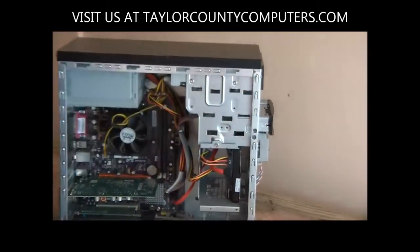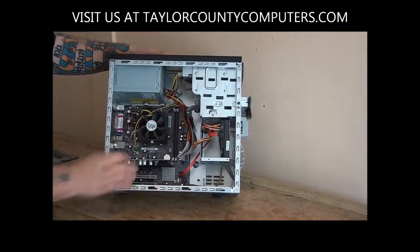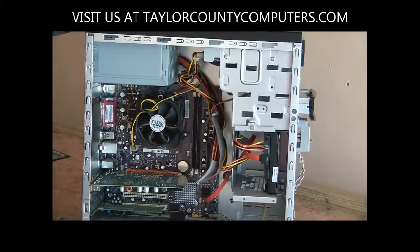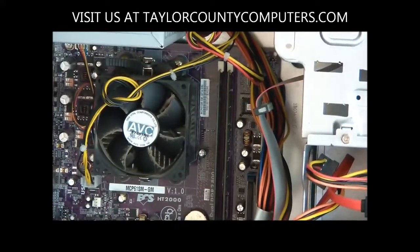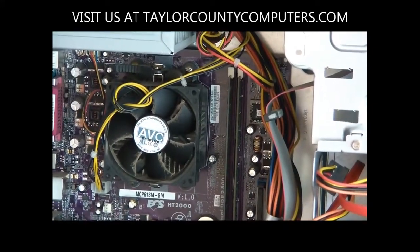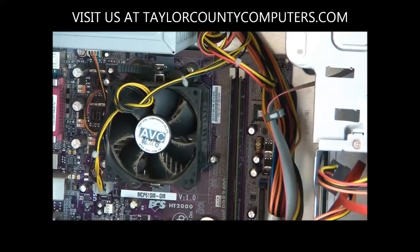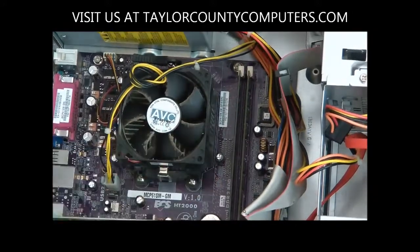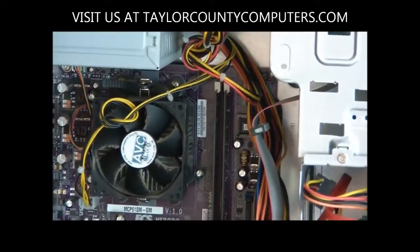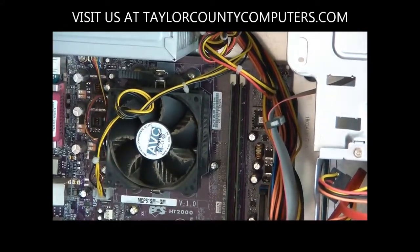Okay, now we've got that blown out. I'm going to show you right inside here, right underneath this big fan, is what's called your CPU, your central processing unit. It's basically the brain of your computer. So you want the brain of your computer doing all its mathematical processes. It gets really hot. You want to try to keep it as cool as possible. So they create this heat sink in the back. What that heat sink does is it's these little metal fins, and the heat rises off of it and helps dissipate that heat to try to keep it cool. And the fan helps pull that heat off there also.